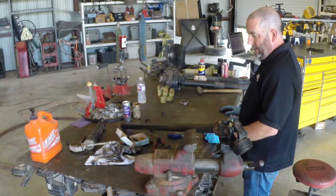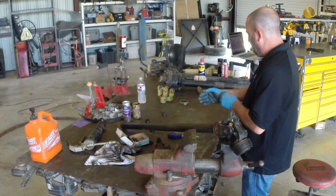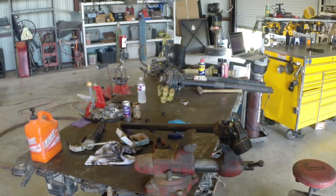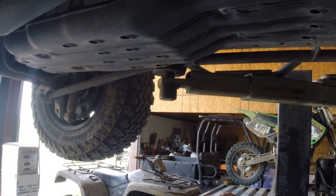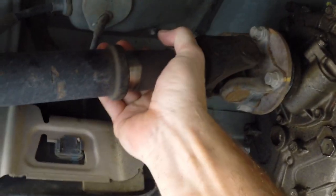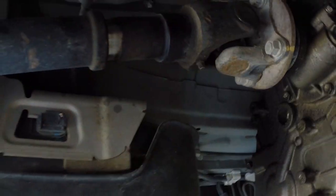So let's go to the car and do some inspection on the drive shaft — let's talk about how to look at a propeller shaft. I've got my wife's FJ up in the air. We want to make sure there are no dents or dings in this prop shaft anywhere — that causes stress risers which can cause it to fail. We want to check for play.